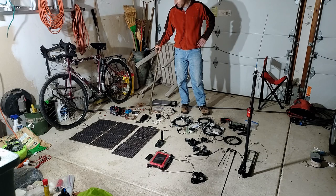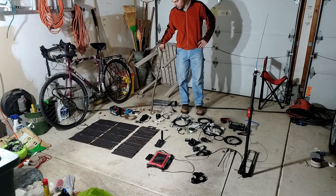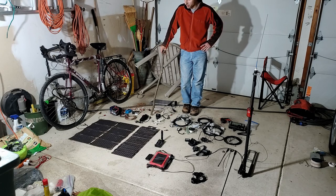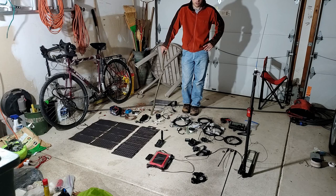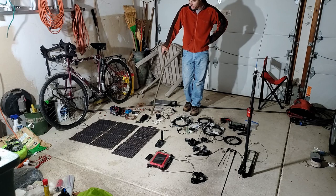And that kind of brings me back to another idea I've had of putting a hub generator or a wheel generator on the front, not necessarily a hub dyno. In fact, I want to stay away from those. They just put out too low of power for the amount of money that you're spending for them. But if I can build something somewhat modeled off of a homemade wind turbine alternator, maybe have a few different size coils, depending on if I'm cruising downhill, then what's a little bit more drag? So why not take advantage of it and switch in a higher wattage set of coils? So I've got a lot of ideas for that later on, but that's a whole other subject, I guess.